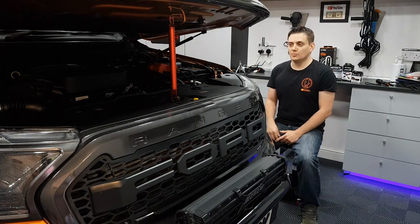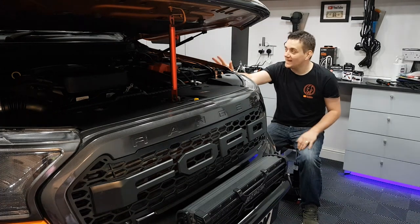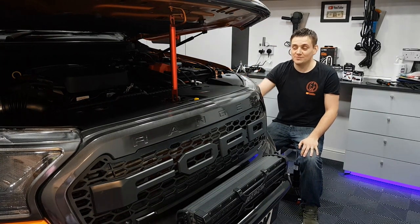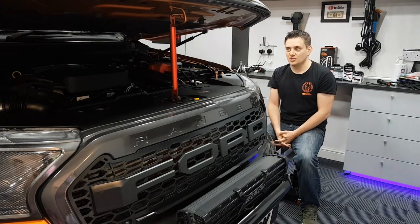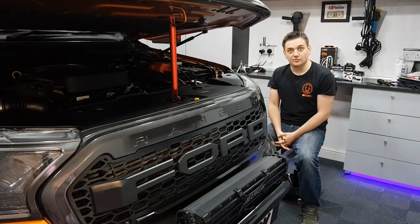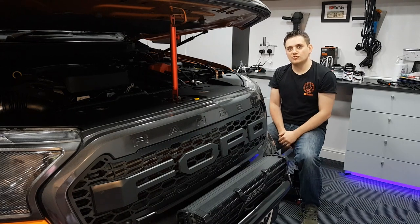With the UK lockdown for over two months, my Ranger simply hasn't moved. Rather silly - I left the dash cam connected in motion detection mode and that has run down the battery to the point of various issues. The major one being that it was no longer able to crank - I couldn't actually start the truck, so I've had to put a battery charger on to get that going.